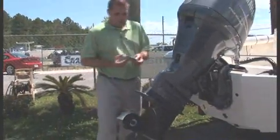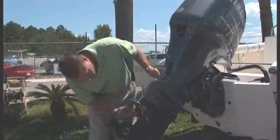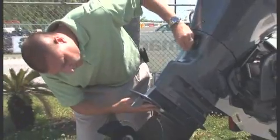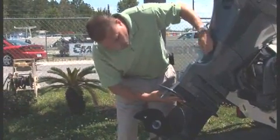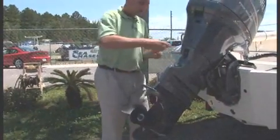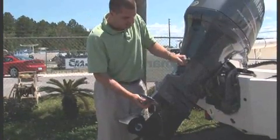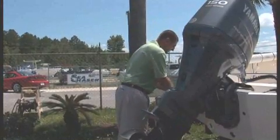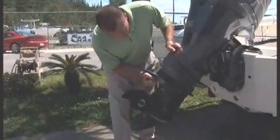This other one — the electrolysis actually got to the inside of it; you can tell where it ate the entire bolt housing off. When they start to show signs of wear and tear, or if it's been longer than about two years, spend the 12 bucks and buy yourself a new one. So you saw exactly what we did: we took the 12 millimeter socket and simply unscrewed the bolt from the bottom of our anode. When you have the new anode ready to go on, you simply line it up with the bolt that's already inside the motor housing and set this one back exactly where it came from — which is one click off of dead center to the right. Just a 3/8-inch drive — everybody should have one of these in their toolbox on their boat. Get it a nice snug fit, not overly tight, but snug.